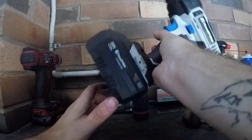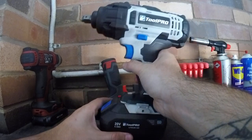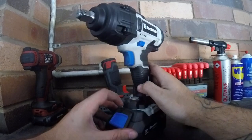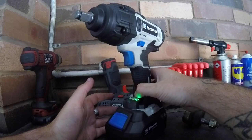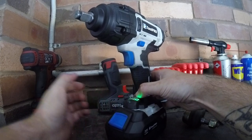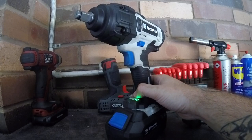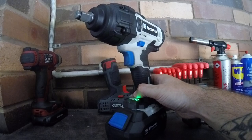The pros of this: it's solid. This weighs in at about 2.4 kilos, plenty of power. It maxes out at 400 Newton meters — not 100% sure how accurate that is, but I have pushed it and it does undo hub nuts that are torqued to 300 Newton meters.